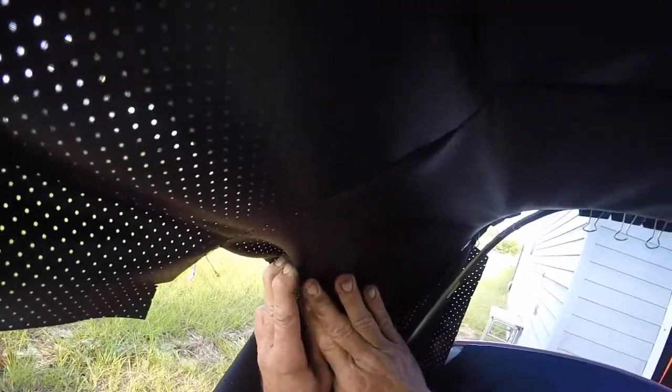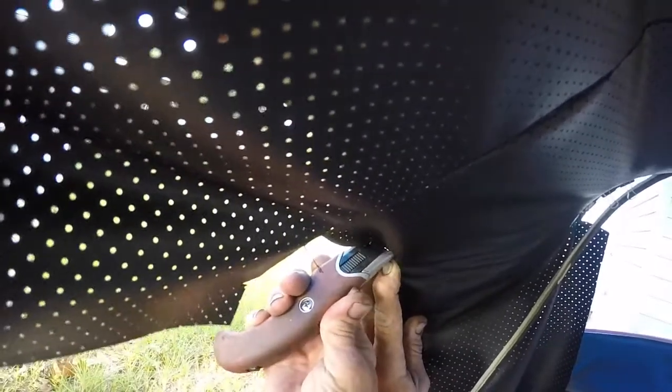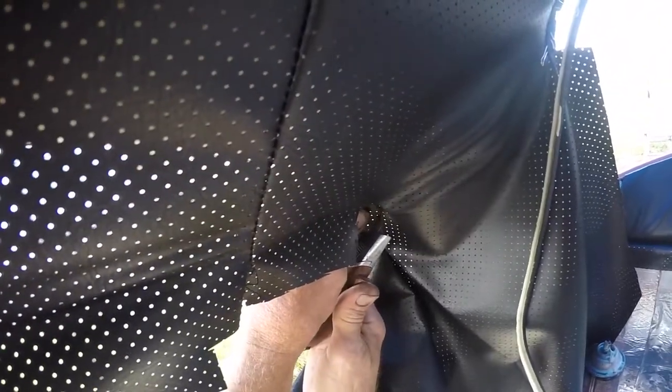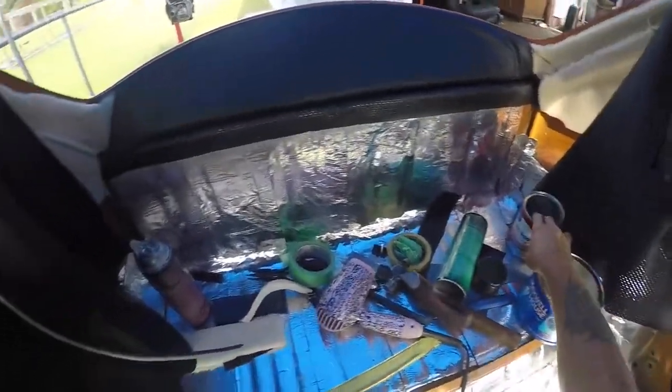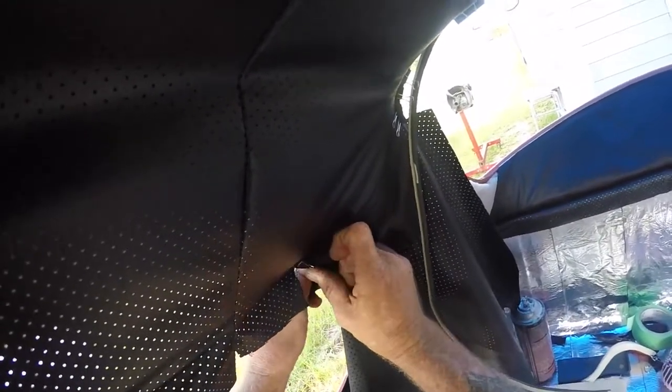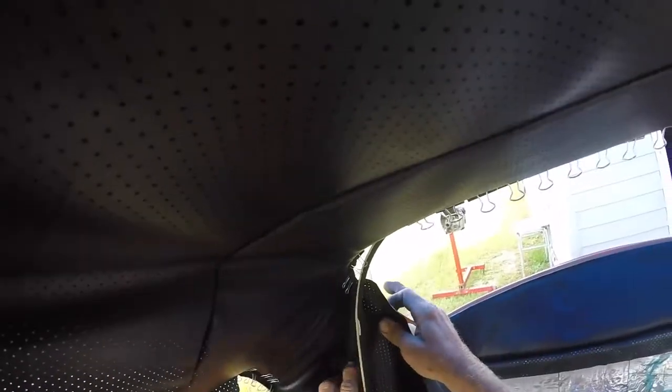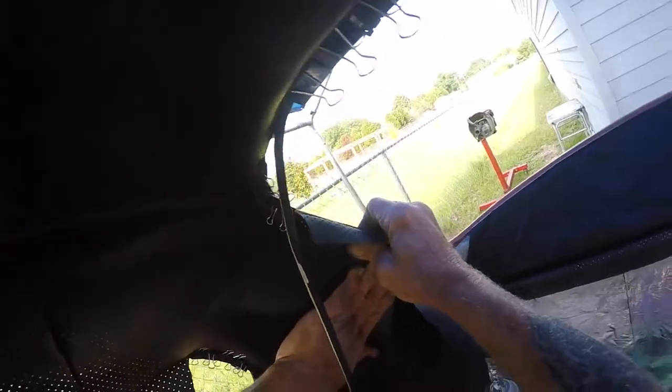Now I'm going to pull on it a little bit and figure out where I want my relief cut. Stay safely about here, pull it real tight, and leave yourself about a quarter inch before the edge — you can always go back. Get a couple of clips, even small ones. On my last relief cut I'll put one extra. Now you see the wrinkles — that's where you'll work them out. Get the defrost tab back in there. Start getting this tucked. That's looking nice.